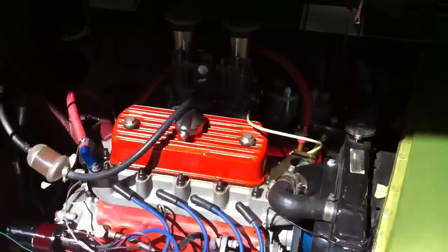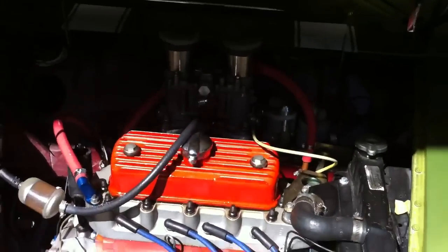On this car here — pardon the Chevy orange and the burgundy background, I think the engine got built before the car. You can see in here that our clutch pedal is nothing crazy. People say 'the pedals aren't even' — you can see the clutch is quite a bit lower than the brake. There's not a lot of wasted travel — I'm pretty much on the throw-out bearing right there, no halfway down before you've engaged. You can see even with two fingers there's my free play, and now it's doing its work, and really by here it's released and you still have room to go to the carpet.